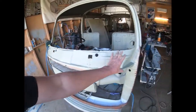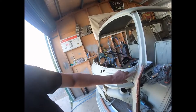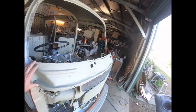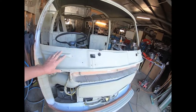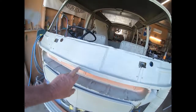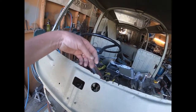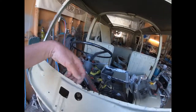Now this was all completely knackered. Let's just say it was knackered. So this one was cut from a wreck down the back because we had it there and it was still in good condition. So this one was welded into the correct place. It's all plugged and ground back across the front of that because it has to line up with there. These couple of bite marks here, you wouldn't worry about them. When the outer skin comes on, that can be filled with weld and sanded smooth.